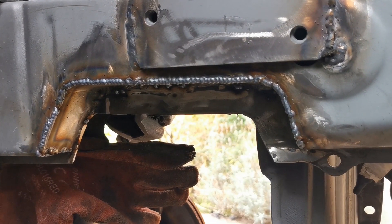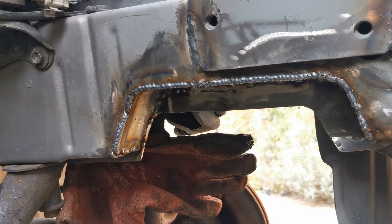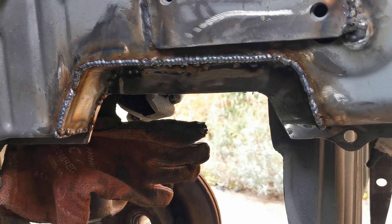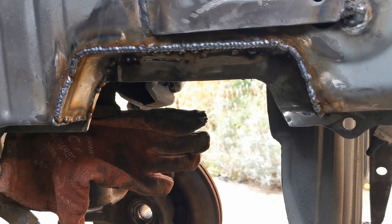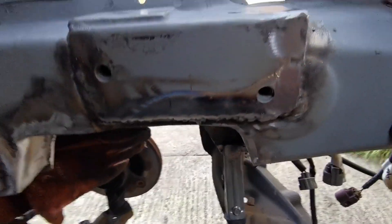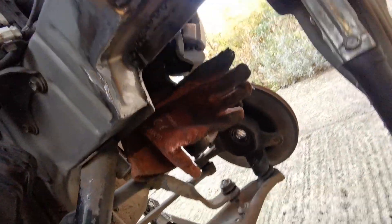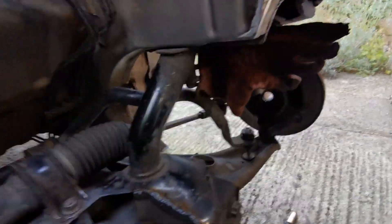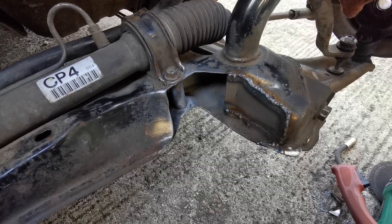That's it - that's one patch welded in, one to go. This takes a long time and I'm pretty sure I'm inevitably going to die because of the amount of burning underseal I've breathed in. But one in - just need to flat it all back with the grinder. I've been smashing on with this a bit off camera because it's a bit samey, just welding and grinding. Anyway, that section of chassis is now boxed and finished, and I've started doing this bit in two pieces because there are some really funky shapes here.